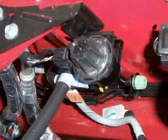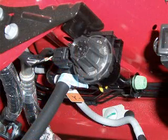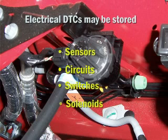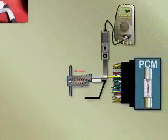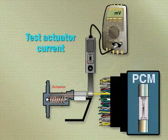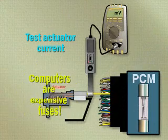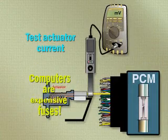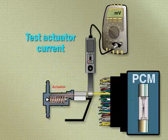In addition to DTCs stored for leaks, the EVAP system can also store codes for electrical faults in sensors, circuits, switches, and solenoids used within the EVAP system. Component faults should be diagnosed with a scan tool, wiring diagram, and standard electrical tools. It also pays to test the amount of electrical current in the solenoid circuits when they are energized. This is especially important when a shorted solenoid fries a computer control circuit. Remember, the computer is the most expensive fuse in any circuit. Use your low amp probe to test circuit current quickly.